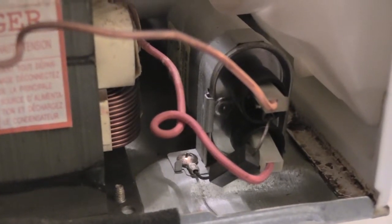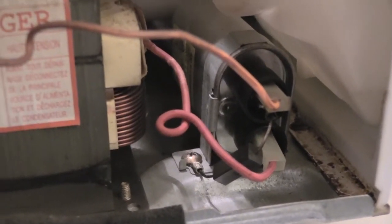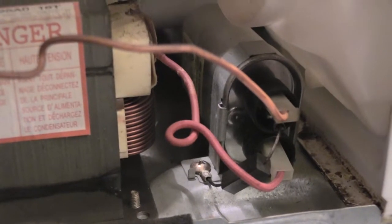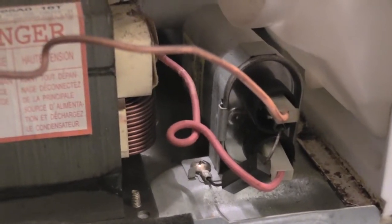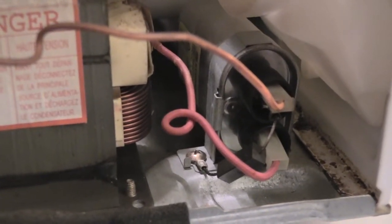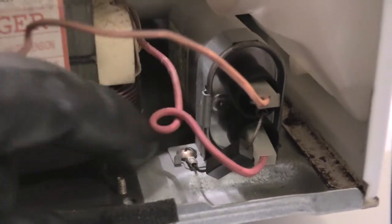You want to be very careful when dealing with your capacitor, because your capacitor actually carries a voltage. Most of them have an internal resistor that slowly diffuses the voltage, but you want to make sure that before you start working on it you thoroughly discharge the voltage from it. Normally you can do that by taking a pair of needle nose pliers and touching both sides — make sure you have rubber-handled needle nose pliers. If you're not comfortable dealing with capacitors, get somebody who knows about it, or find videos on YouTube showing how to discharge a capacitor.